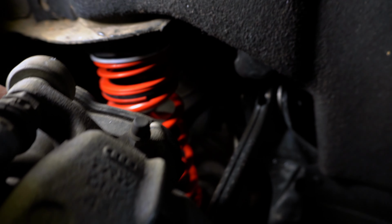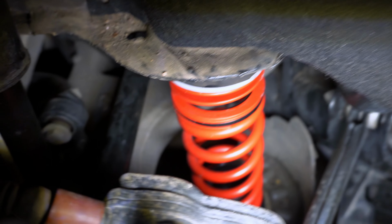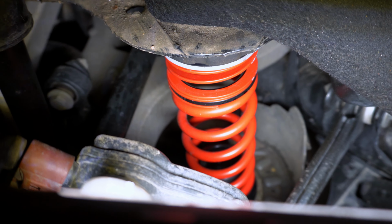at home. Now the important part here is a lot of people seem to struggle with the rear springs. It's not difficult at all, and actually, one person can do it pretty easily. Let me just get the light positioned here. Okay, so this is the rear spring housing. There is enough room. You can take a basic spring compressor, and of course this is with the factory spring.